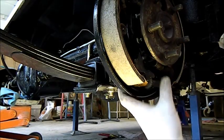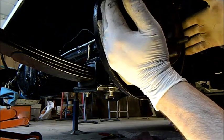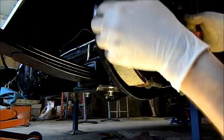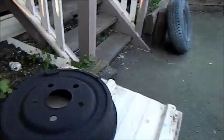There we go - that should keep that adjusting nicely. Brake adjusting tool in, flick it off the bottom wheel - that's what we want to see, excellent. I'll centralize them - I always run my finger around and knock them into where they look central. Then we can get our drum on. I've lost one of these things so I'm going to buy four new ones - they're pretty easy to replace. I've just painted these drums with exhaust paint. Now we adjust them up and bleed them - we've filled the master cylinder and we're doing a bit of gravity bleeding. You can see it's all coming out beautifully down here. We've already done the left hand rear - it's just the right hand rear, and then once the lines are charged we can start bleeding properly.